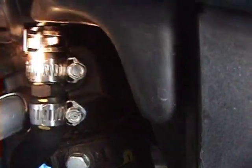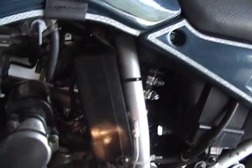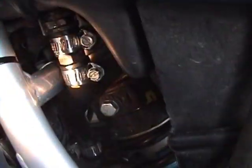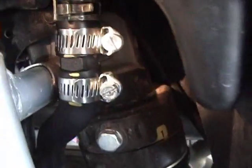Got the hose back onto the air box. Down there, I also replaced this rubber thing, which didn't seem to be doing very much, with another hose clamp that you can easily get to from this side of the kickstand safety switch. Mount it back up. Make sure that the numbers right there are right side up — that's a big thing, otherwise your valve isn't going to do anything.